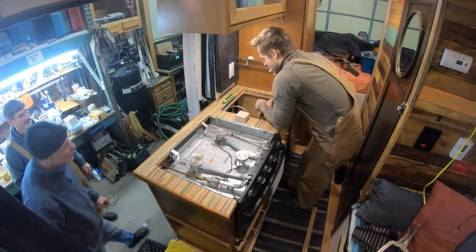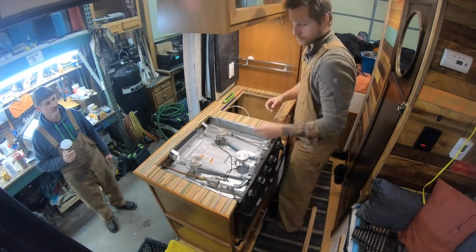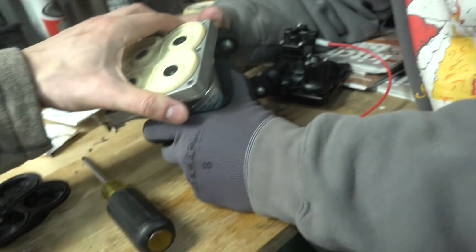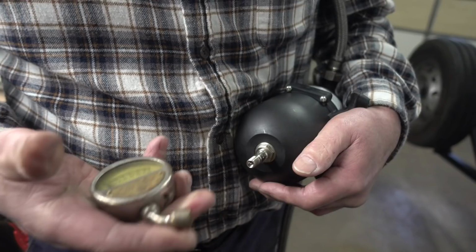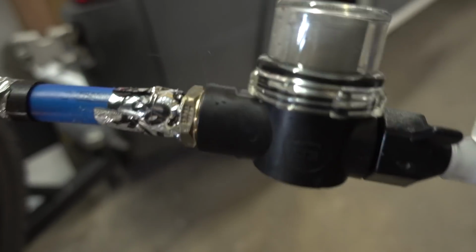Then once we got in there, it was like chasing this leak. We couldn't find it. You're getting air in your lines, you're never going to hold pressure, and my pump never shut off, so we spent months trying to find it. Replace the pump. Replace the accumulator, the balloon. Nope, that was fine. Then we screwed with the filter. Finally we were blowing in it, and we could hear it leaking. We figured out that that was bad, and the connection it had was bad too, because that was a Teflon wrapped piece, so we replaced that as well. That took forever, and that was a lesson learned.